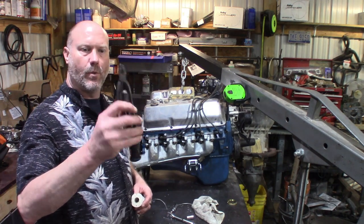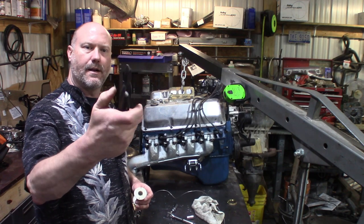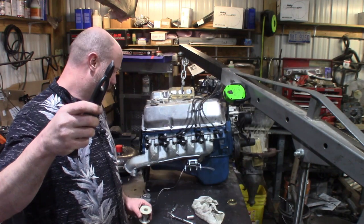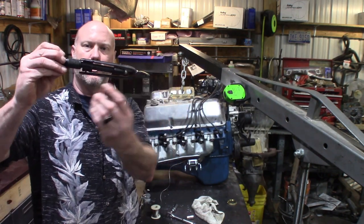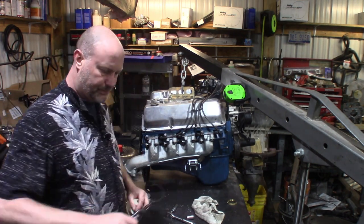This is a 6-inch safety wire pliers that are locking. You close the jaw onto it, pull down on this little tab, and that keeps them locked so the jaws can't open. Then while it's holding on, you clamp it onto the two pieces of wire, and then you pull this handle out. It's just easier to show you.